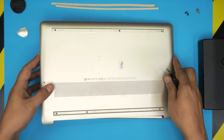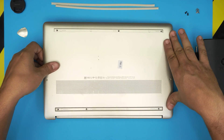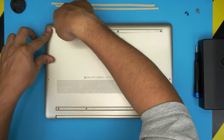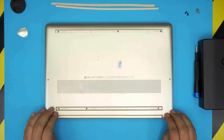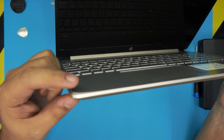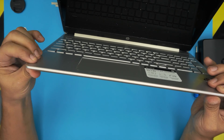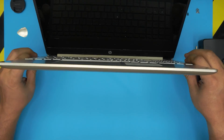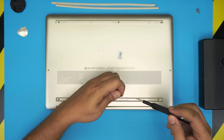Once the new SSD is installed — you can install up to two terabytes with no issue — grab the bottom cover, bring it on, and push it down toward the screen. You want to hear those big clicks locking in on the back and in the middle. Open it up and if you see any gap, just pinch the top and bottom together firmly and it will snap into place. Do the back corners too in case they're not locked. Once finished, put all the screws back on the bottom cover.